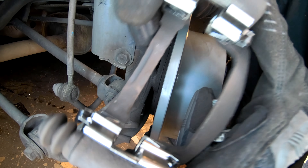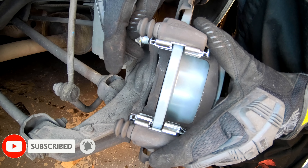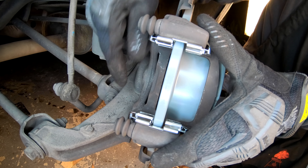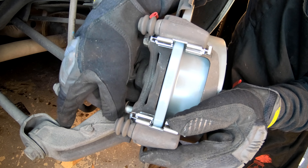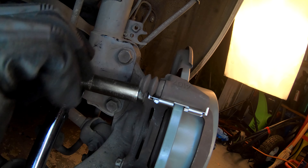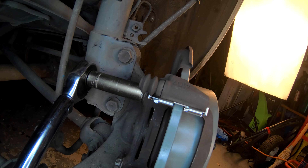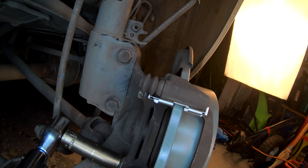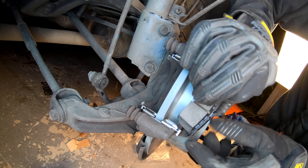For the slider pins, I'm using some synthetic brake grease — you will find links in the description below to purchase the parts and tools shown in this video. Install both your upper and lower caliper bracket bolts into the hub. After you snug up the caliper bracket bolts, you are going to torque these 17mm bolts down to 79 foot-pounds of torque. If for some reason I'm off, please comment below with the correct torque specification. You will find links in the description for torque wrenches if needed as well. Make sure they're both properly torqued down before you move on.